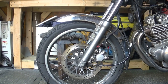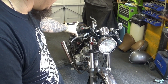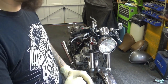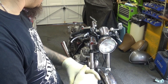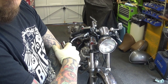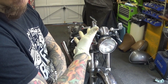We've got brakes on the front — first time ever since I got the bike. The master reservoir was completely messed up: screws were missing and there was no pressure whatsoever, and obviously the front caliper was completely seized up. So we've got brakes. I'd like to take it for a test ride but I really want to change the oil and the filter first. I can see there is oil in there but I don't know the quality or when it was last changed, so before I go riding I'm going to change the oil. It doesn't take much, so let's get it done.